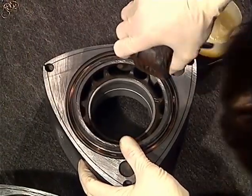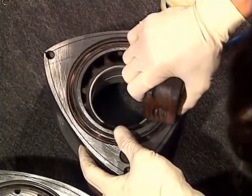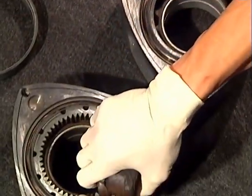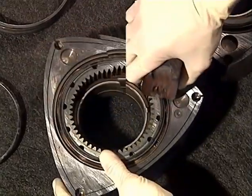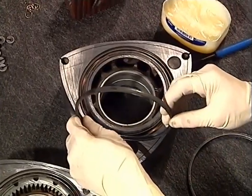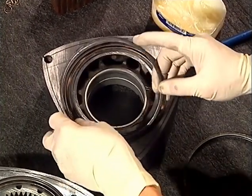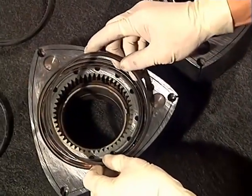We use a piece of wood that's been sanded smooth to help with the installation of the oil rings into the rotors. Keep on pushing down carefully on the ring, walking around the ring until you feel it seat. The outer ring is more difficult to install — be careful that you don't slip because it may cut you. Install both rings in both forward faces of the rotors.